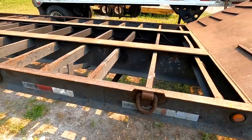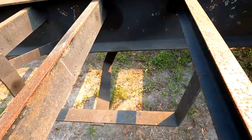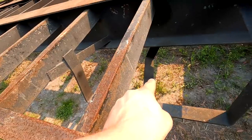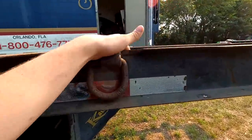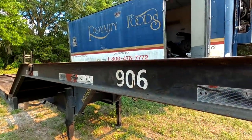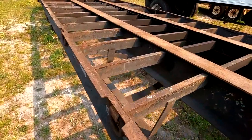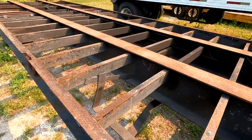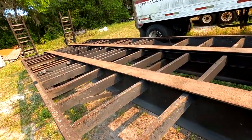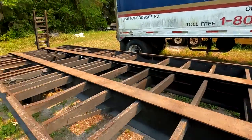Now to go over the visible damage on the trailer — there's a lot of welding that's gonna need to be done. This right here is a spare tire holder and that strap that holds it got caught on something and got bent, so we're gonna straighten that out — a lot of big hammering is gonna happen there. Most of the places where the tie-down hooks are kind of bent and not right. The big thing sticking out is it doesn't have a wooden deck on it. The previous owner said it started having problems, so they ripped it all off and knocked all the old bolts out — which is actually nice for us because Chas and I have put a lot of decks on trailers and taking the old bolts out was always a major pain. I already got brand new deck screws ordered.